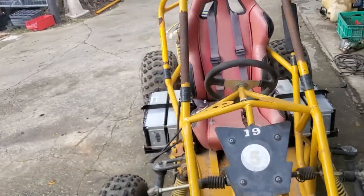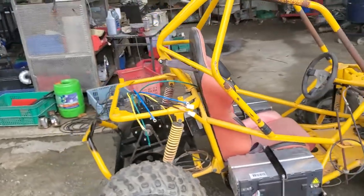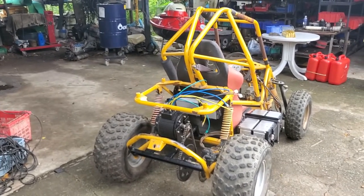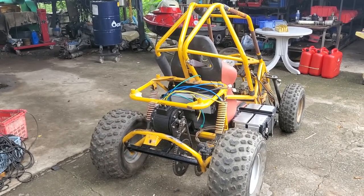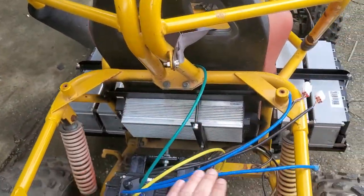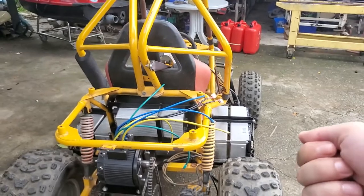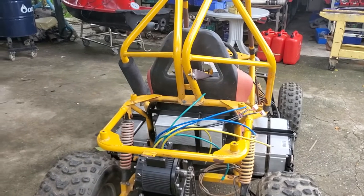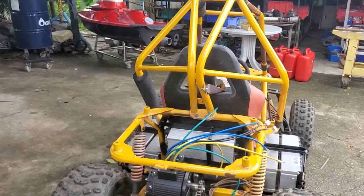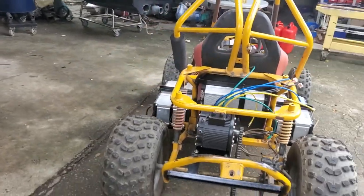Everything will be beautiful on this vehicle. I want to make it into a showroom vehicle so I can be eligible to go to a motor show and showcase technology. Motor shows always advertise themselves as innovation of the year — well, zero innovation. They always sell the same garbage every time. What you need is something like this for real innovation. We'll also have the charger over here with two different charge level modes — you can charge from any plug or from an AC fast charging station, Level 2 basically. The maximum output of the charger will be 4.8 kilowatts, so you just need the AC 22 kilowatt station for fast charging. These battery cells are automotive-grade CATL cells and can handle it no problem.